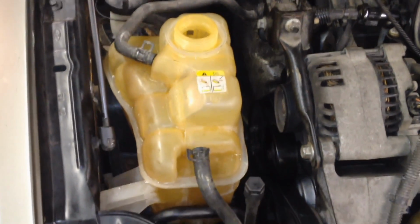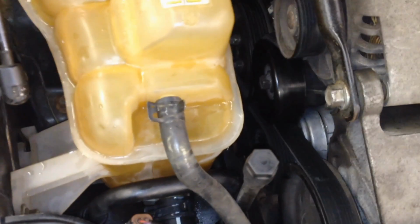Bolt your coolant bottle back in, and then we'll connect up the 3 hoses, the 2 bleeders, and then your main one down there. At this point, I think we can start filling everything up. A few last connections down here. We got our O2 sensor, blue and green, and then your other one up there. Let's see. There it is, up here.